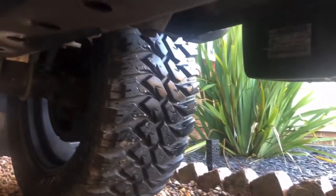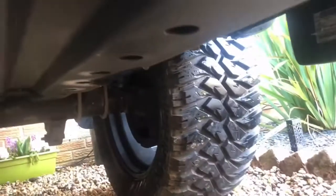It is an automatic, so here's the automatic gearbox transmission with a very long prop shaft. There's a rubber stop to stop it wiggling, going all the way into the rear diff. There are drive shafts in there driving the back wheels. I believe the front is definitely disc brakes, but the back might be drum.